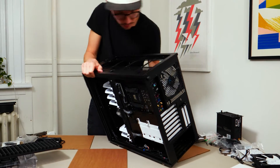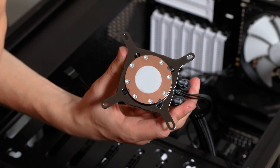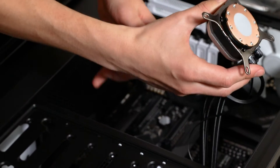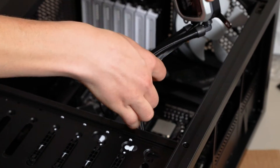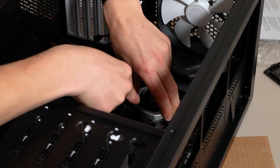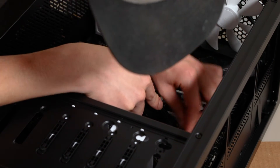In a cooling setup there's a part that actually touches the CPU and it's gonna have some sort of thermal paste on it. In most setups it'll be right on there already — you don't need to touch it. If there's plastic on it, just peel it off and it goes straight on top of your CPU. Sometimes you might need to apply it yourself, which is a little nerve-racking but definitely necessary. Be careful not to touch it or disturb it too much — just pop it right on.